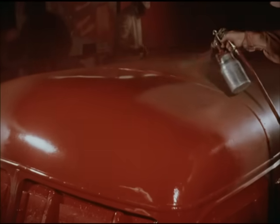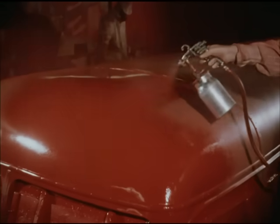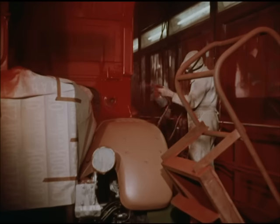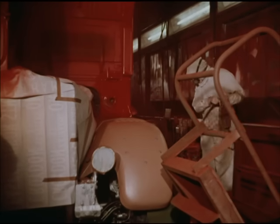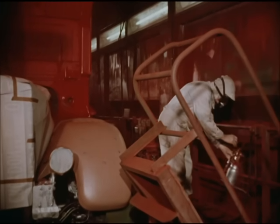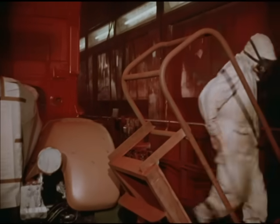For speed and binding property, wet top coat goes on wet undercoat. And then, two coats of varnish, each oven dried at 130 degrees Fahrenheit. All to produce a protective skin, proof against corrosion and rust for three and a half to four years. After that, it begins to deteriorate. And that is why every bus in London's entire fleet must be overhauled in that period of time.